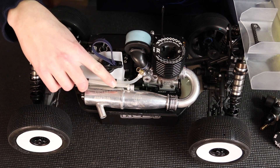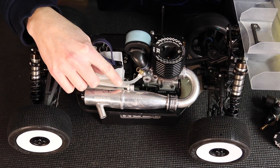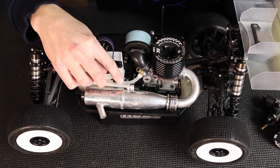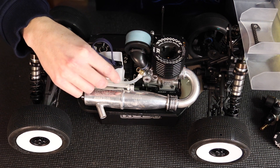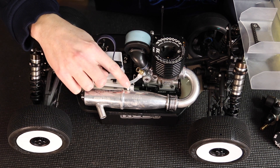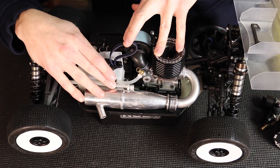Moving down to the fuel line — keeping it in good shape is very important. This fuel line gets hot, and since these cars run for a long time you need to replace it once in a while. You can tell when it's time when the fuel line starts to turn brown; I usually do it every second big race to make sure everything is fresh. That's why you use clear fuel line — it's easy to tell if it's good by checking the color. I also put zip ties on to make sure the connections don't come off; they have a little barb but I like the extra insurance. I put a zip tie where the line connects to the tank as well.